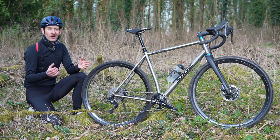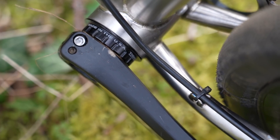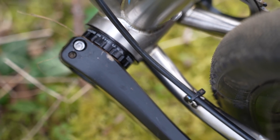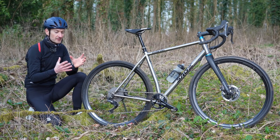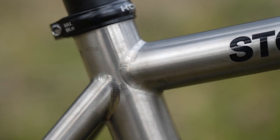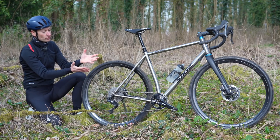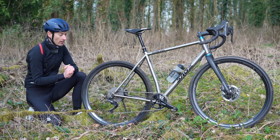There are lots of other nice sensible details on this bike, like a T47 threaded oversized bottom bracket — a standard developed by Chris King and Argonaut quite a few years ago, two US companies trying to solve the problems with press fit bottom brackets — and being adopted by big companies like Trek and small companies like Sage. Through the months of riding I've had the bike, there's been no issues at all with creaking or squeaking or anything like that.